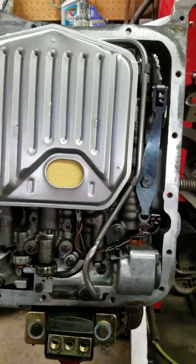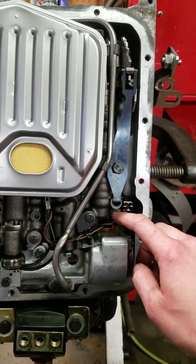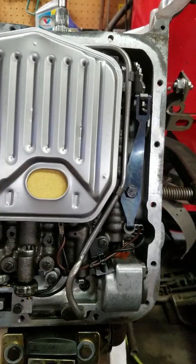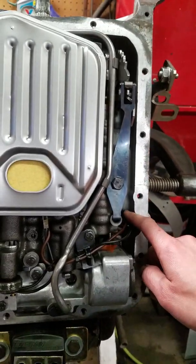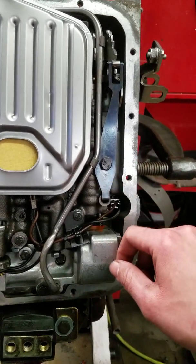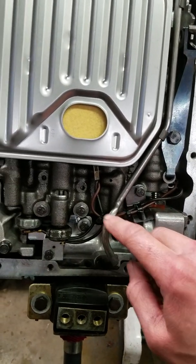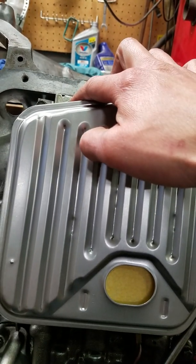The simplest way to wire it: you have a main power coming in that you're going to run through a brake switch, and then have an on-off switch to arm the system. So your main power going from your on-off switch through your brake switch comes in here, and that wire is going to run up and go to your lock-up solenoid.